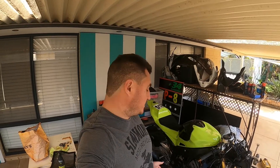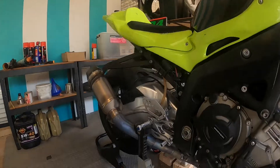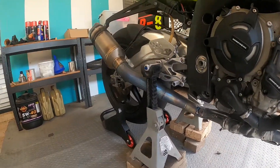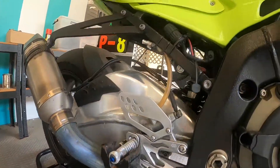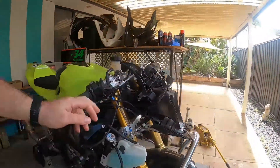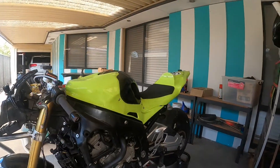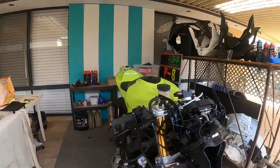Welcome back to the channel. About time I gave you an update on the BMW. It's just had its suspension serviced. You can see it's still up on chucks — I've supported it by the foot pegs, jacked it up. You can see the rear stand; it's higher than what the rear stand would normally allow, and this is fully drooped down so that I could pull that rear shock out. Forks got serviced as well, so it's time to get it back down, get it back together, get ready for the next track day.